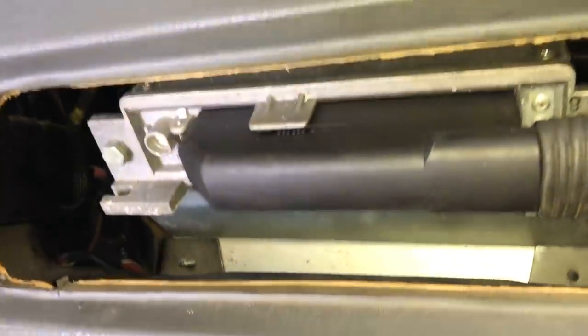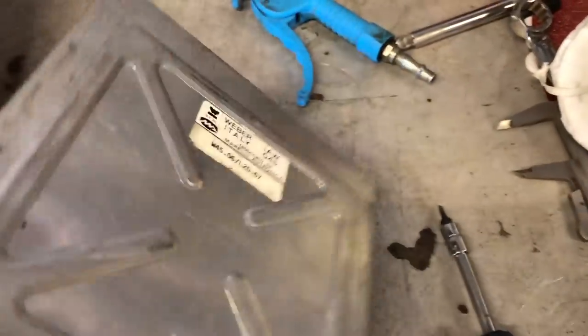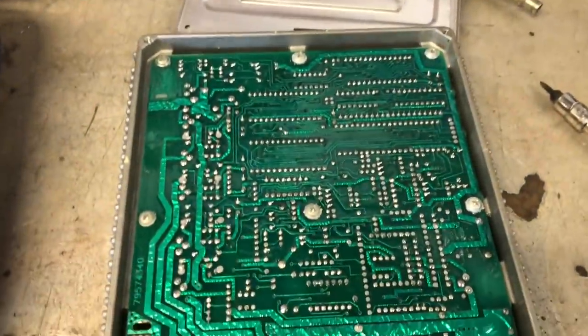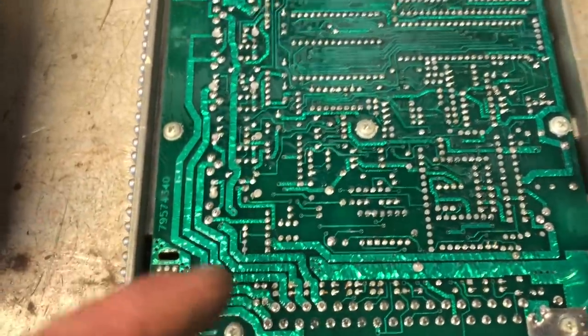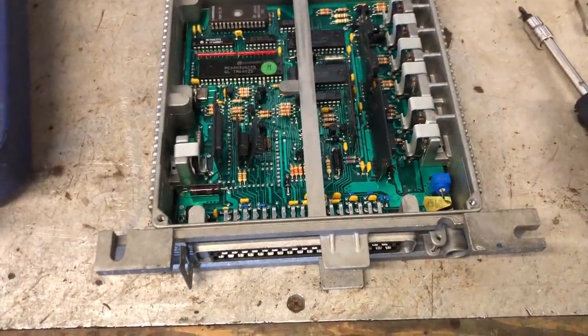I've disconnected the battery, for anyone that is worried. The ECU was there in the dash behind that panel. I can't prop a tripod in here, so I'm just going to get this unbolted and cut back in. Looks like there's just those four little tiny screws. I don't know which side the chip's going to be on, so we'll start by undoing this side and having a look. There's absolutely nothing to see on this side — it doesn't look like anything's been changed — so I'm going to pop that cover back on and turn it over.